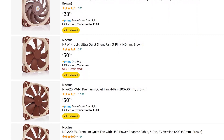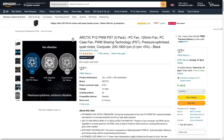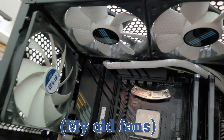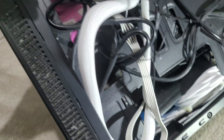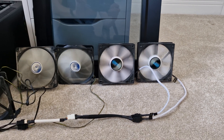To be honest, many fans are actually quite cheap to buy. Premium 120mm fans cost around £30 or $35 in the UK, for example. I recently purchased five Arctic P12 fans and a fan hub to replace these old case fans — the fans only cost me around £5 or $6 each, so I wouldn't personally bother taking them apart and re-lubricating them. As to why I changed these case fans and ripped off the fins — it has nothing to do with the old fans failing. They all still spin at the advertised RPM rates more than a decade on, which is pretty impressive. I simply wanted a common theme for all my fans — previously I had three different types which didn't look great. Since my case is black, the new Arctic fans blend in really well. I also switched out my old Phanteks fan hub with an Arctic one, and my system is now super silent. I get full PWM control on all five fans and they often run at around 1100 RPM, which is really quiet and keeps my system cool.